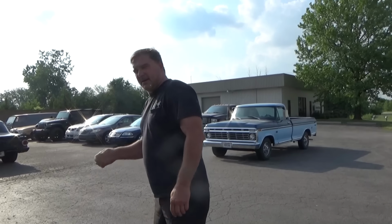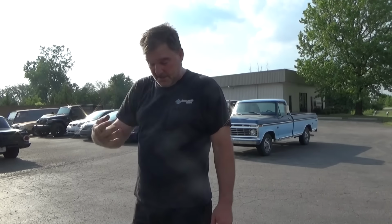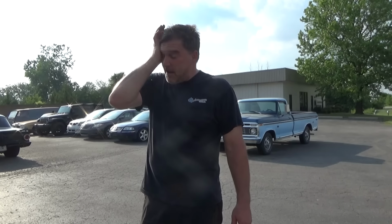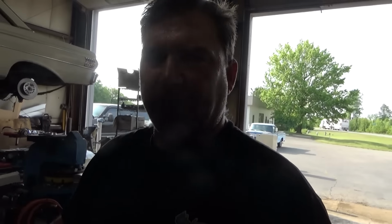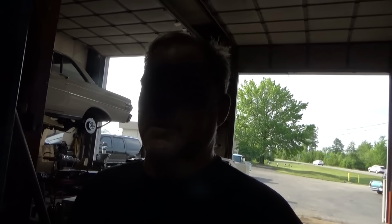That one off right there. The brakes are garbage. It probably needs a brake proportioning valve. It has the correct disc, like Corvette style master cylinder in it. And the pots are the same size, so the master cylinder should be good. I've never had good luck with those smaller diameter boosters. They've never really worked right in my time. I often end up pulling those out and putting something else in, but we'll see what happens with it.